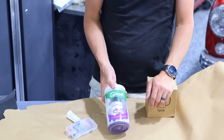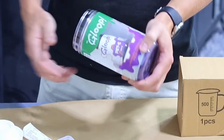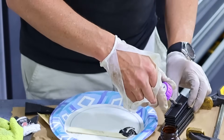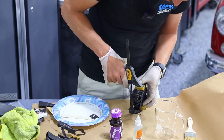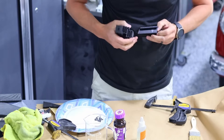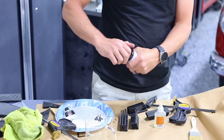I've got some new product to try — this is called Gloop. I've got 3D prints where I just need to join sides and there's not a lot of surface area, and this is specifically formulated for 3D prints, so we're going to give it a try. It comes with some syringes and applicators. I'm going to try three different methods: superglue, Gloop, and JB Weld. We'll clamp all these together. After about an hour, the Gloop was better than the JB Weld, which is good. That's good enough for me — we're going to go with the Gloop.